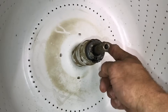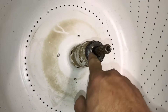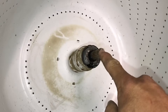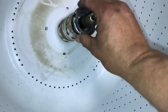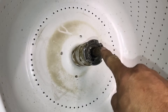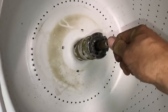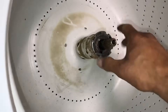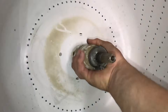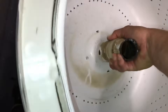The trick was this drum — it's been on here for 12 years and there was so much corrosion around this drum block right here that it wouldn't come up. So I simply used a three-jaw puller. I put the spanner nut back on, put the three-jaw puller with the center here and the jaws around here, put some pressure on it, tapped on it, added a lot of penetrating oil around it, and finally the whole thing broke free, the block and all. You've got to take the lid off first — the cap.